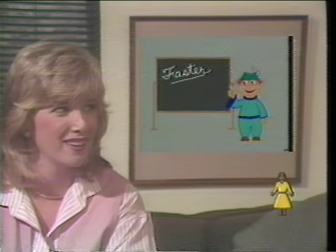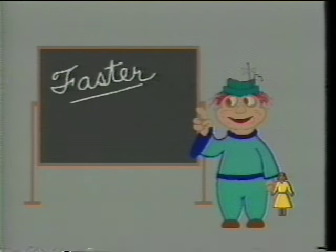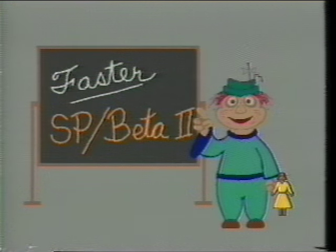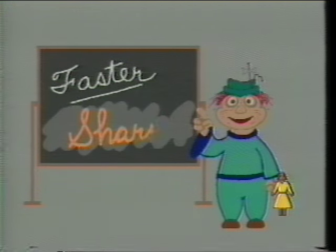Well, keep in mind, the speed you record at does have something to do with the quality of the picture you wind up with. The faster the speed, and that means the SP or standard play speed in VHS, or beta format's beta 2 speed, will make a sharper picture than the slower speeds, which expand your taping time but give you a grainier picture.